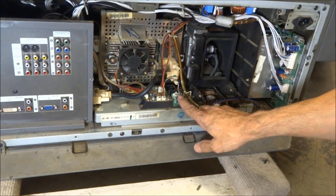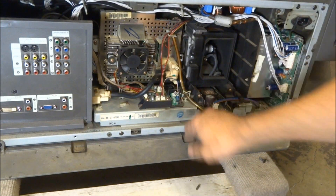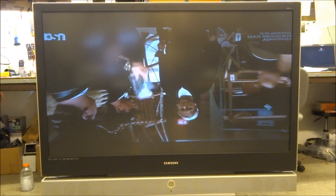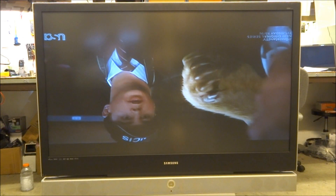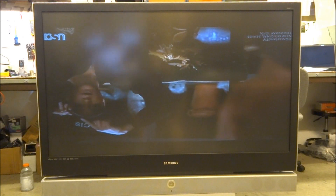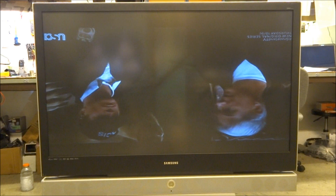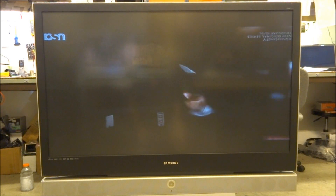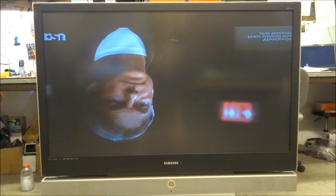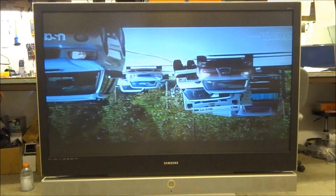If you don't put the back on, you'll need to trip the safety switch — I just wrap the wire around it; otherwise the set won't run without defeating that safety interlock. I applied power and fired it up, but got a fan error message on screen — one of the leads had gotten into the lamp cooling fan, keeping it from rotating. I pulled the engine back out and redressed those wires. With that fixed, everything looks awesome on the TV — except the picture is upside down. So let's go into the service menu and turn the picture around.